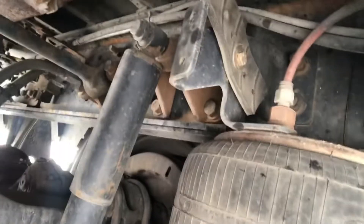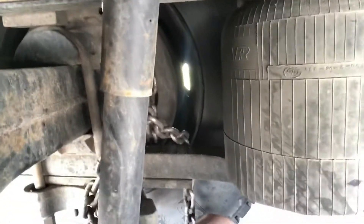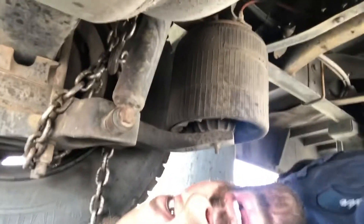I'm going to take my chain and we're going to go — I don't know if you can see it — up and over the frame rail. I'm upside down here. Then around that leaf spring — we're going to wrap the chain around it, terminate it back to itself, and that'll hold the axle up when we pick the tail end. I opted to pull the line off the leveling valve. The chain's going up and over the spring, down the back side. You can see I got it going between those U-bolts — it keeps that chain off that shock so you don't damage it.